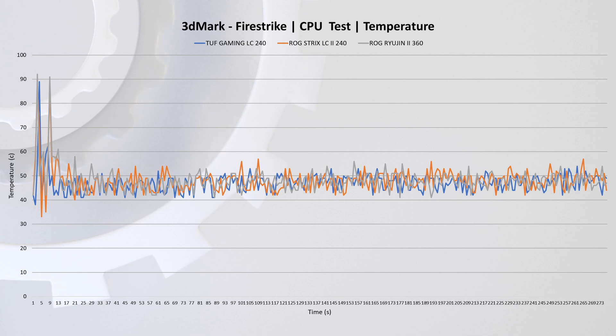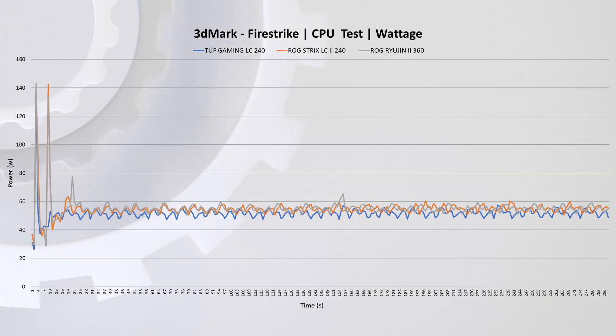For those who may not use their PC for heavy productivity tasks but rather gaming, the next benchmark is the Firestrike test by 3DMark, simulating 1080p gaming — in our setup it ran at around 100 FPS. In the thermal graph it's actually hard to tell which cooler does better, since in gaming performance keeps fluctuating with changing scenes. Looking at CPU power consumption, the TUF Gaming cooler results in the system pulling less power, while the Strix and Ryujin coolers clearly kept the chip cooler, allowing more thermal headroom so the CPU can boost more efficiently.